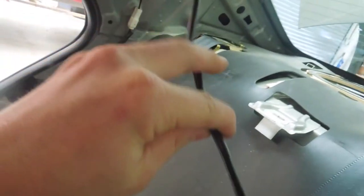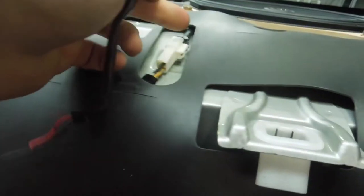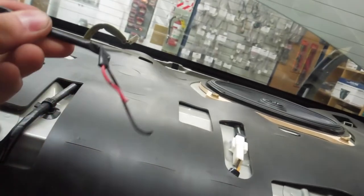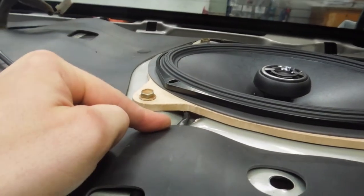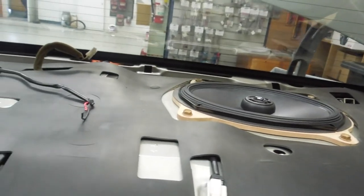This here is the cord which came off the factory speakers. They were soldered onto the terminals and then they plug into these plugs. So basically you just do the same thing — it's a really nice and tidy way to do things rather than soldering and putting new crimps on everything. You just solder this end to the speaker terminals and then it's able to just plug straight in. You can see there's a gap there intentionally for it, so it just goes through that gap and onto the terminals.